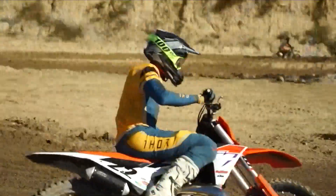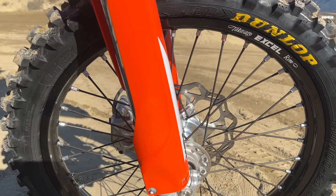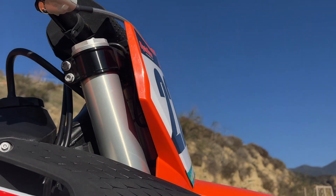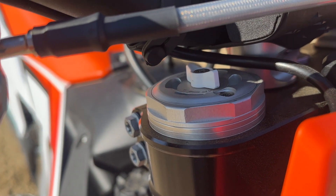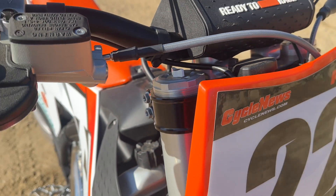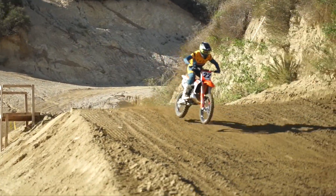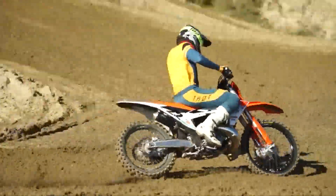All the KTM bikes are now on the same frame, which is really comfortable. The fork and shock are getting better and better — I'm always impressed by the air fork, especially if you haven't ridden one in a while. The bottoming resistance is improving, and riding through braking bumps it hops through a lot easier and lighter than you'd anticipate. The fork and shock also have toolless adjusters — plastic dials for compression. I went out one click on the compression to get the fork to go further into the stroke in one section coming down the hill where it was feeling vague and standing up. That solved my handling issues.